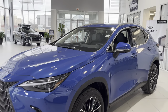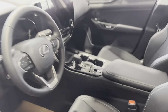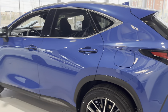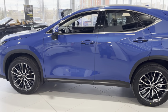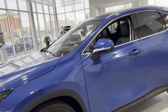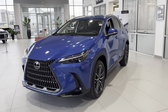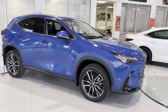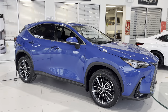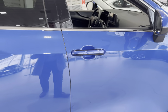You can also place it in charge mode by pushing that top button on the console. You can recuperate up to 80% of electric range just by driving the vehicle. So if you have a full charge of 64 kilometers, you can get it back up to around 50 kilometers of range just by driving in charge mode. In charge mode you do burn a little more gas compared to hybrid mode, but you get some extra electric range — it's kind of a win-win. If you're commuting 100 kilometers and put it through charge mode, you can get about 10–20 kilometers of electric range just by driving it like you would a regular car, so you don't even have to plug it in all the time.